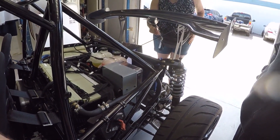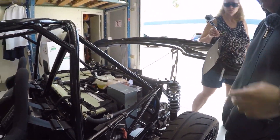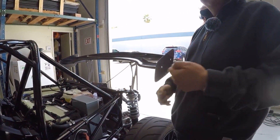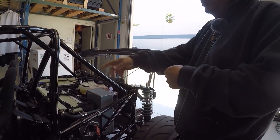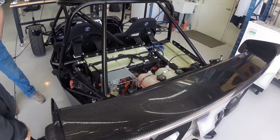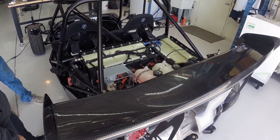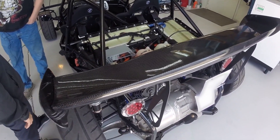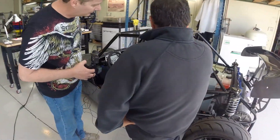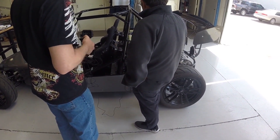Teslas have their own connector that you can convert. We used J1772 because it's the most standard — we could have put a Tesla connector on it. There's line, neutral, ground, and two pins for proximity and signal — that's the gist of the connector. That has to be wired into the appropriate inputs of the Tesla charger for it to function. We're using what's called a Tesla Tap to convert from the Tesla connector to J1772. Outside I've got J1772 chargers we can use natively without an adapter. So you need a DC-DC and an AC-DC — those are the two items behind the seats.